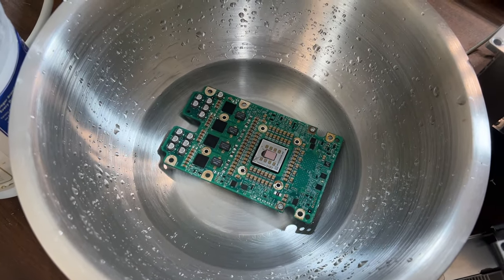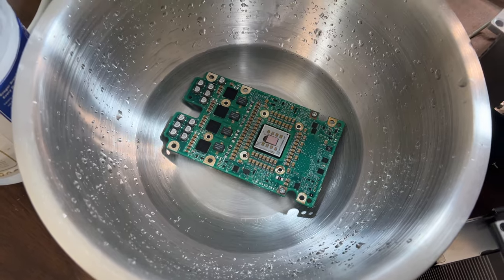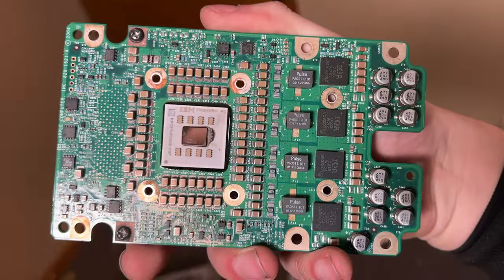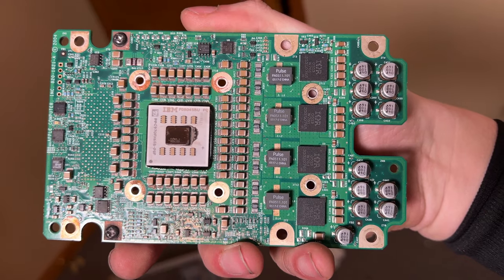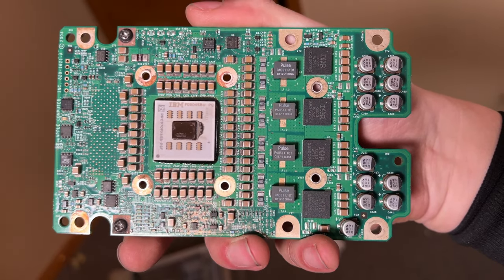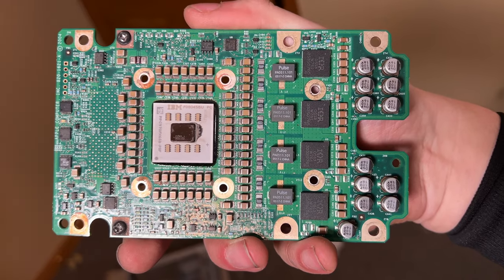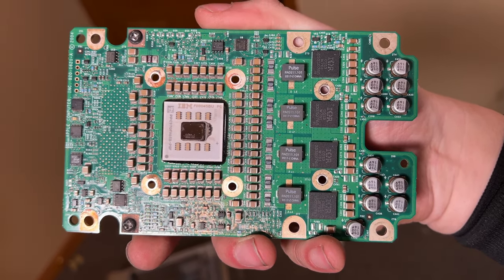When I poured all the vinegar on it, it started sizzling for a second there. So I guess it's now neutralized, and now I have to get all the vinegar off of it. I'm going to scrub it down really good. It smells really bad in here. There's no more blue whatsoever left on this card. I should have used vinegar last time I cleaned these CPUs. I may have already had the system working. Something tells me this card's still not going to work. But now, who knows, the two on the cooler down there may actually have one that works after you vinegar it. It's amazing how quickly it dissolves all the crystals.